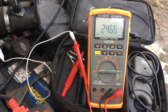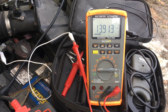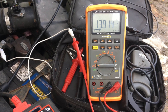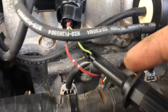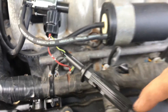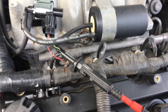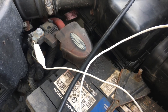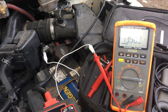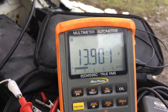With the VIAS solenoid off, and now with the VIAS solenoid on — with the solenoid on it actually gets regular running battery voltage at that connector. The way I have that connected is I'm using the negative lead of my multimeter on this green wire with the yellow stripe, using a special piercing tip that allows me to pierce the wire carefully while doing minimal damage. For the positive terminal on the multimeter, I've attached that right to battery positive. So if you measure it that way, with the VIAS solenoid activated, you should have operating voltage between those two points.